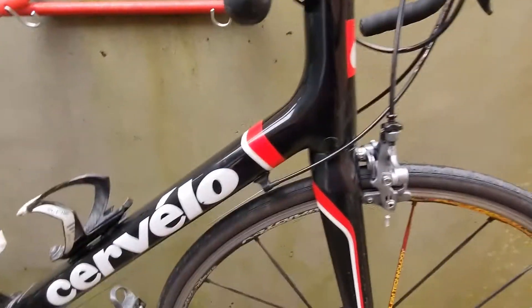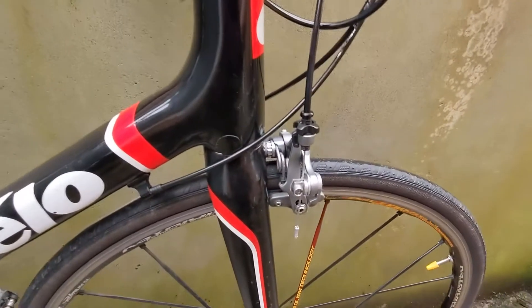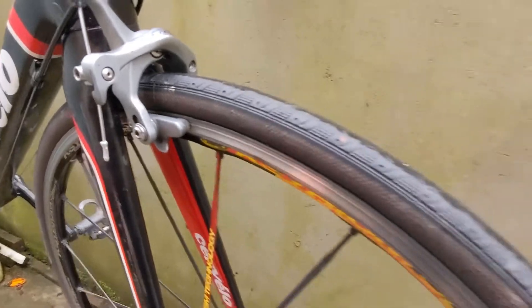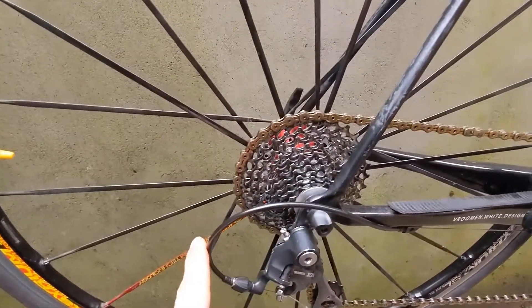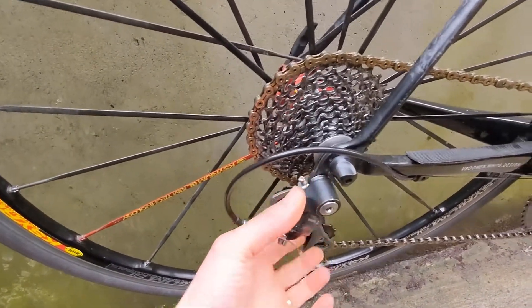With the Silver Service, brake cables are changed — inners and outers — working nice and smoothly, balanced and set up correctly on the rims. We check your rims as well, making sure they're not worn in if you're using rim brakes. We take the seat post out, give it a clean, fresh carbon paste or grease depending on the bike, and pop it back in. We check the rear brake and the derailleur — new gear cables and if need be a new B-spring.